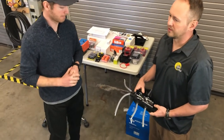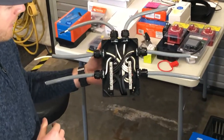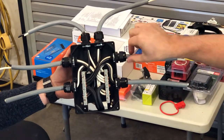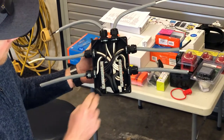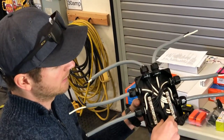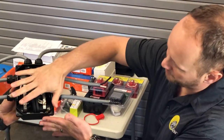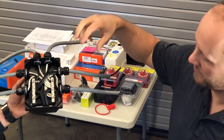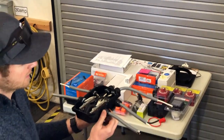Tell us about how the solar panels are connected in this combiner box. This is a combiner box mock-up we've made — you can see six ports here, though typically not that many on a van roof. Each panel comes in in parallel: two wires for positive and negative go into one port. We're only going to be using two ports for this build. Then we go to either the negative or positive bus bar with those cables. There's a larger cable here that reflects the solar cable that penetrates the roof — this whole combiner box gets sealed so there's no weather damage, and this is the cable that goes down to the charge controller. That's the 6-gauge duplex I talked about. The box is designed to cover the hole and make everything weather tight — we drill the hole, put putty in, fill it with DICOR sealant, seal around the combiner box. The lid has a gasket and weather-tight strain reliefs to keep any moisture out.